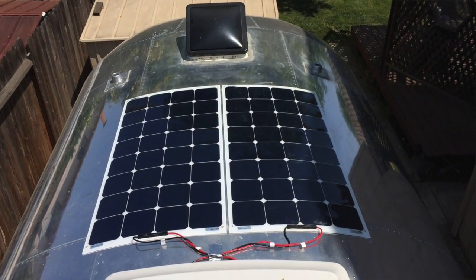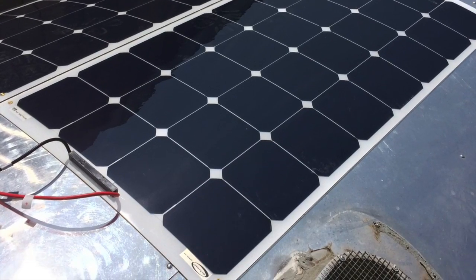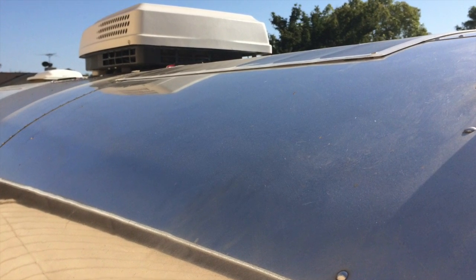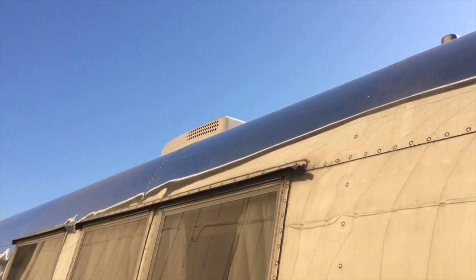There's no maintenance to it other than keeping the panels clean. The panels have a 10-year warranty, so I expect this will last quite a long time. I'm very pleased with the way they look. Since this is an Airstream that's rounded, I wouldn't want to put the glass and aluminum flat panels on the roof — those have to be raised up high to allow cooling underneath, and it just wouldn't look right on an Airstream, especially a vintage one. Some of the newer wide-body models you might get away with it, but a 1960 like mine has much more of a curve. These flexible panels can curve up to 30 degrees and they just follow the shape of the roof — you can't even see the panels when you're walking around the trailer. It's a really great benefit having the flexible panels for something you want to keep looking as original as possible, like a lot of us vintage Airstream owners like to do.